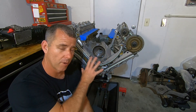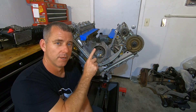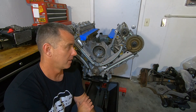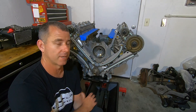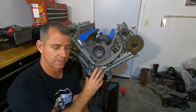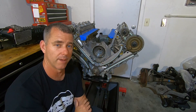At a minimum, if you're only going to upgrade one thing, it's these metal tensioners. These metal tensioners can be used on 2, 4, and 3 valve engines on the 4.6 and the 5.4. A lot of the later 4 valve and 3 valve engines had a plastic tensioner. I've seen them break, lose tension, jump timing, and all kinds of bad stuff can happen. So at a minimum, I recommend you go to the metal tensioners.